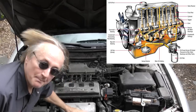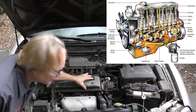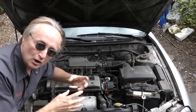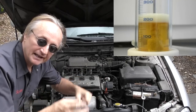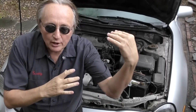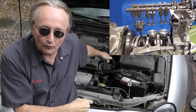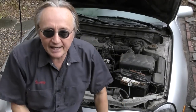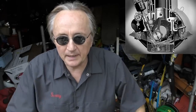Foaming is a really bad thing because oil pumps inside the engine spin around and are made to pump liquid oil. They pump it from the bottom of the engine up to the top to lubricate the camshafts. If you've got foamy oil, the pump can't handle it — foam has a lot of air in it and won't pump correctly. Parts won't get oil that are supposed to, especially in overhead cam engines. The top of the cam won't get lubrication, it'll be starved of oil, and you can ruin an engine that way.